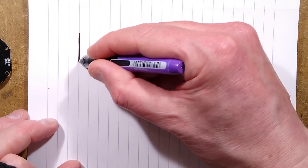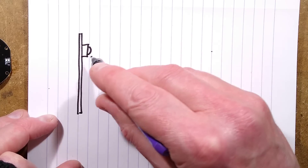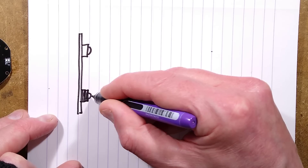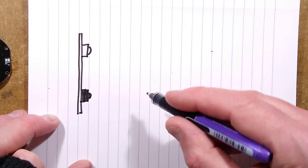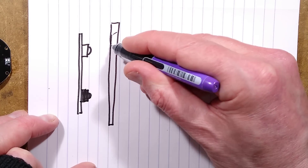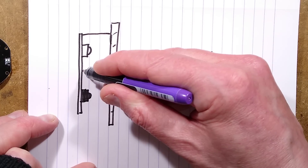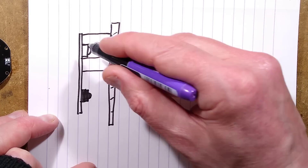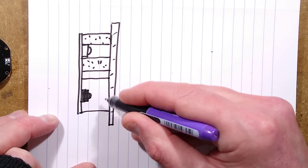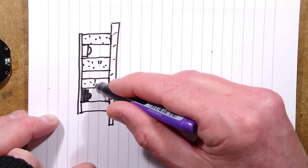Let's show a rough sketch of the infrared unit and how it's working. There is a circuit board, and on that are mounted two chips - one is the infrared emitter made of clear plastic, and the other is the infrared receiver made of black plastic, which blocks visible light but passes infrared. If you simply had these behind the clear cover, you'd get a reflection and it would cause false triggering. So what they do is put in a foam surround with adhesive that physically sticks to the front, and that stops light spreading over between the two of them.